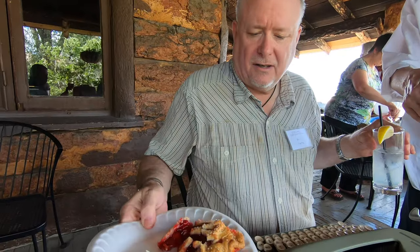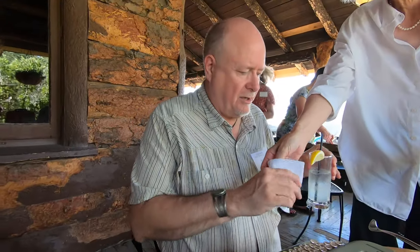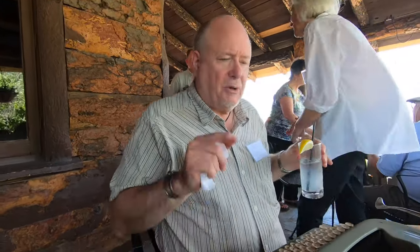And the secret with all typewriter repairs is have a piece of delicious Flying Star apple cherry pie. Cherry pie with you. Yes. And an adult beverage. Of course. But the cardinal rule of any maintenance and repair on a typewriter is make a small adjustment, check it. Make a small adjustment, check it. Go back and forth and back and forth. Don't make big adjustments. Just make a small adjustment. Very good. Signing off. Cheers.